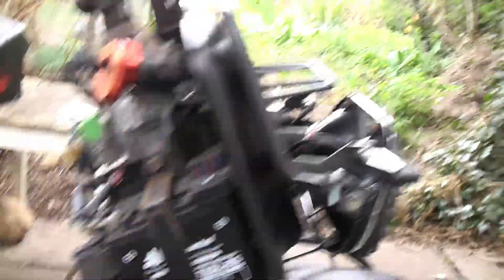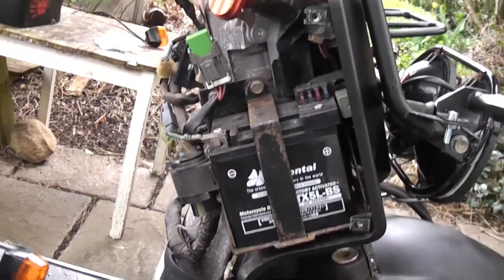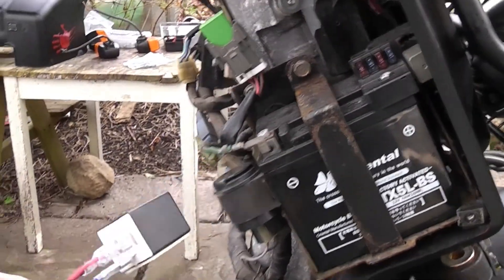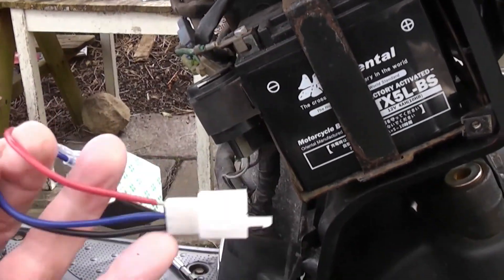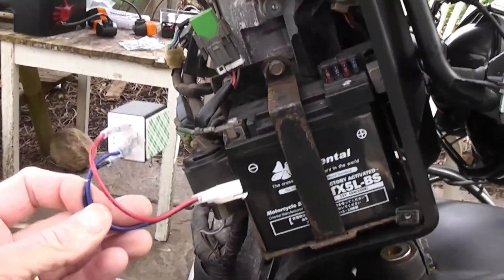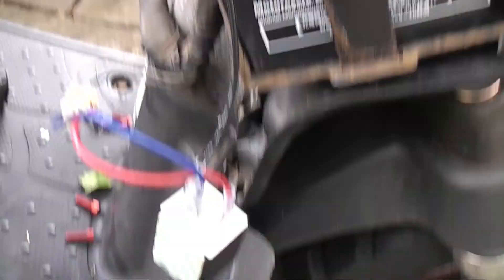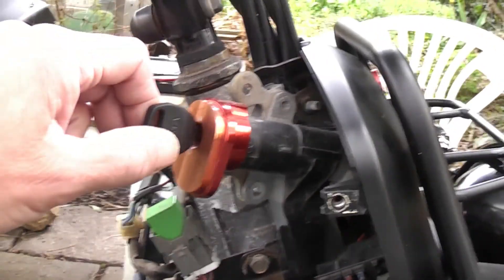When I've got them going, because they're LEDs the flash relay — which is this — I need to change that for one that works with LEDs. So this is a new flasher relay, it's going to replace that one there. This one's got two wires, this has got three wires. The plugs don't have to come off because that won't plug into anything. The reason you've got an extra one is because you've got to earth it to the battery terminal — that's temporary wired in. So one to the battery, one's a positive, one's a feed. We'll give it a quick test.